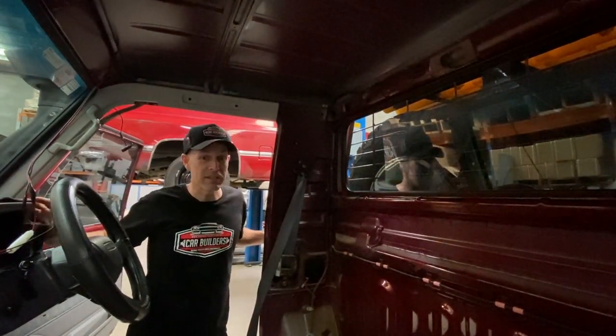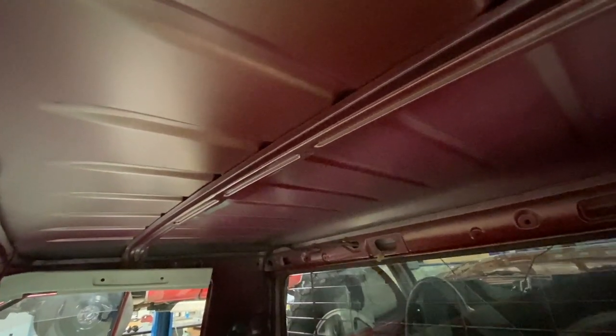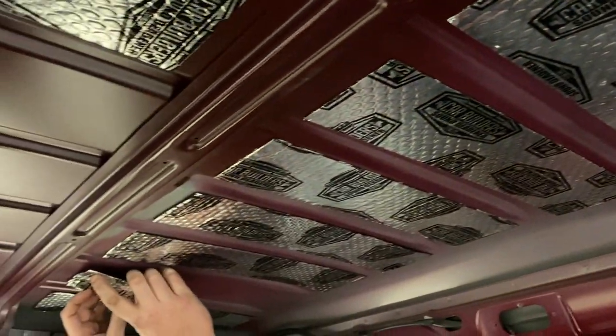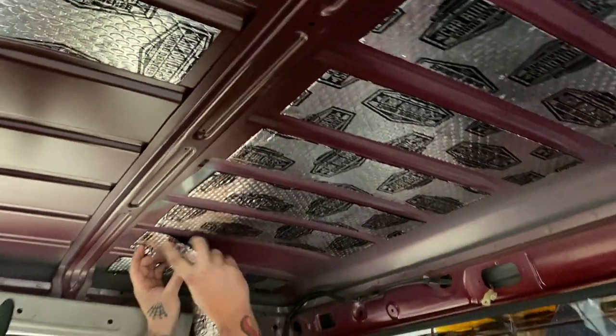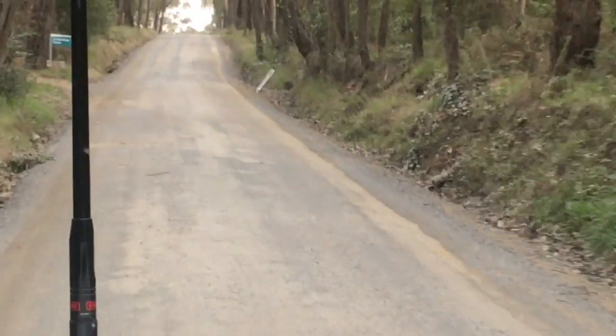You can see here what we're dealing with. In the commercial class vehicles, they don't come with much. We've dropped the headliner — there's nothing in there. The rear firewall, there's nothing there. The first thing we're going to do is put a dampening mat in there. We call that our Stage 1, which is a vibration dampening material that's going to reduce panel vibration. The peak of that in this style of vehicle is going to be on your corrugated roads.